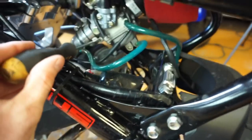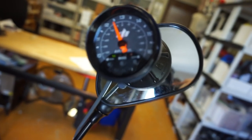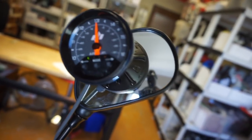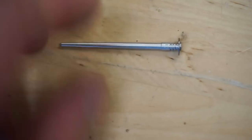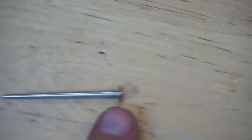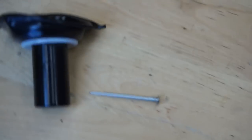So as I adjust the air screw, you can watch the gauge come down or go back up. Since my mid-range was a little rich, I'm going to bring it down. I move this needle down a clip so that it'll lean it up — this is for our diaphragm here. So I'll do that and see what happens.